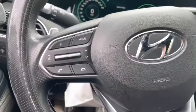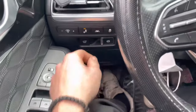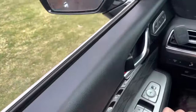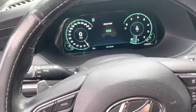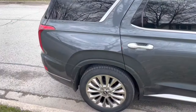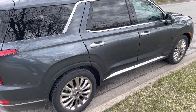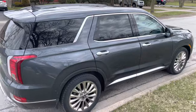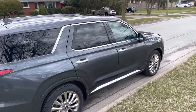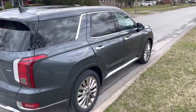Now go for your regular test drive. Put it in drive, make sure you have brakes right away — we've got brakes. Put the e-brake on, let go of the brake pedal — we're not moving, which means the e-brake works and you're ready for your test drive. Test drive went great: no noises, nothing felt weird, e-brake actuates, everything feels smooth. Thank you for watching — if you have questions, comments, or suggestions for future videos, let me know in the comments. I hope this helped you save a few bucks from going to the dealership for no reason.